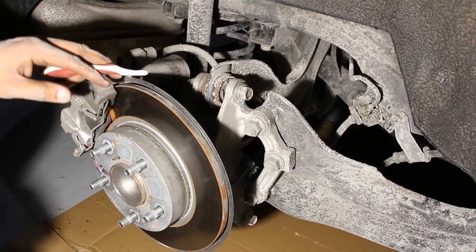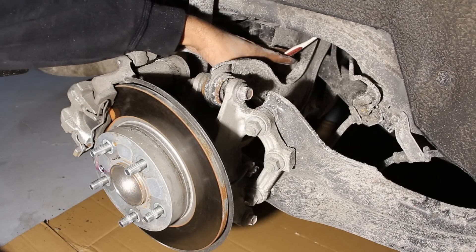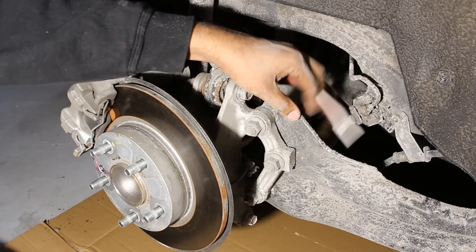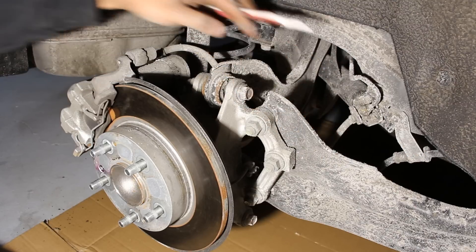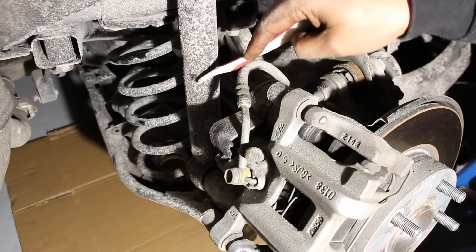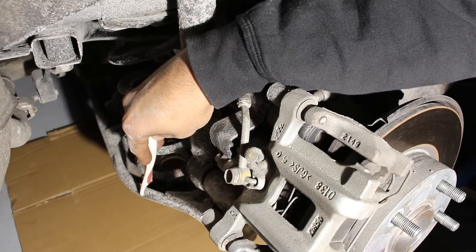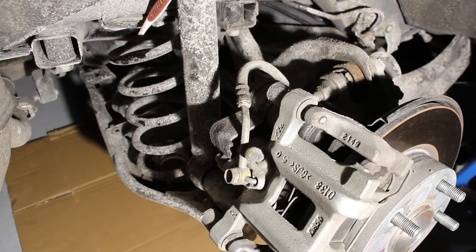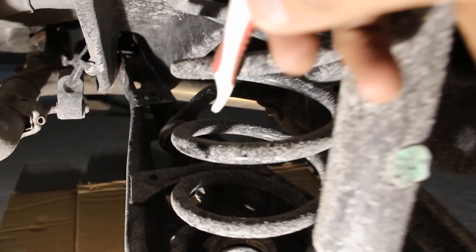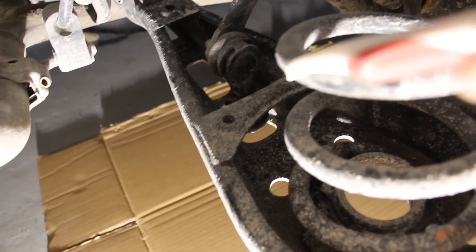Taking a look at the rear suspension, there's a multi-link setup. The upper control arm bolts up to the subframe and comes over to the aluminum rear knuckle. Three bolts mount the control blade to the body. At the top is the shock absorber, which mounts down to the lower stamped steel control arm, with the spring attaching up to the body and over to the subframe. A very small stabilizer bar link mounts to that lower arm and connects to the sway bar on the other side.